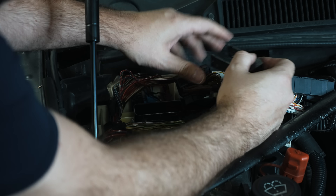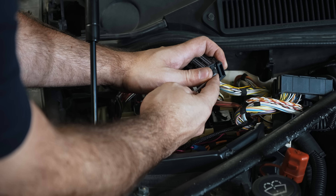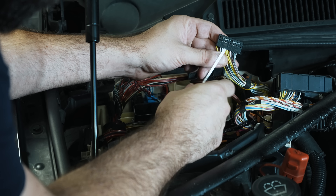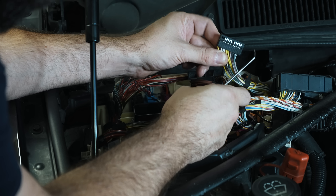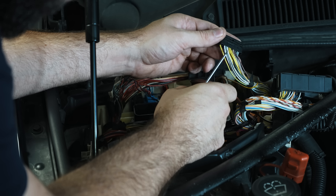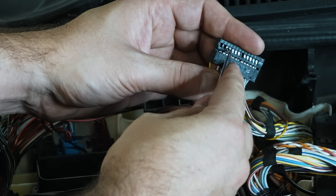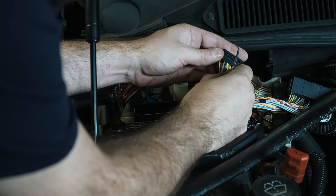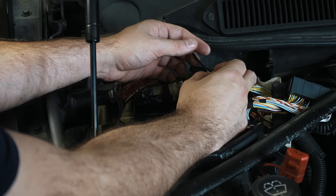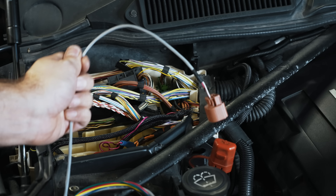Focus on the smaller connector first — get a pick tool to allow it to slide out. On the connector where it says 26 and 14, count three over from pin 14: one, two, three — that's the white and purple wire. Use your pick tool to press on it and pull it out. Then take a small piece of heat shrink tube, slide it over the exposed metal part, and shrink it down so it won't short out on anything.